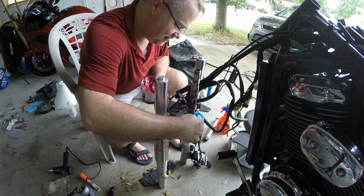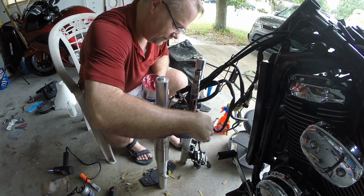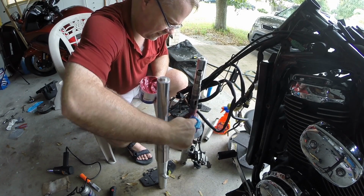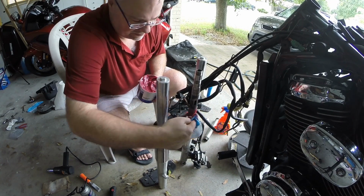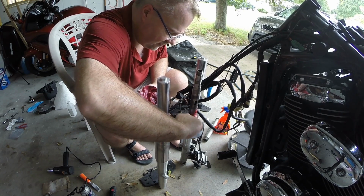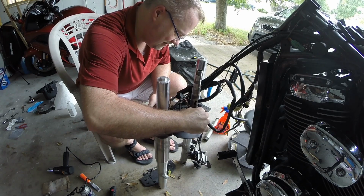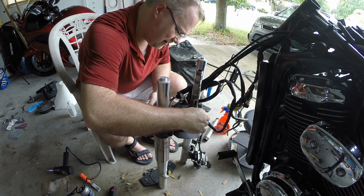Press it in there. Get it under the bearing lip or under the seal lip. Every cavity must be filled with grease. That's feeling pretty good. That heat will help that grease kind of almost liquefy as it gets in all the crevices. Make sure nothing's crunchy. Otherwise, you gotta start over. Alright, we're nice and smooth.